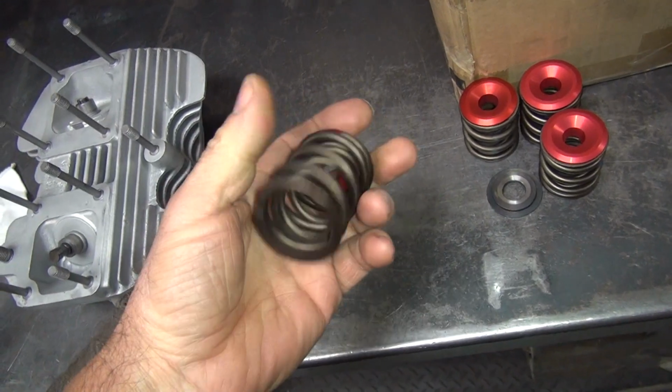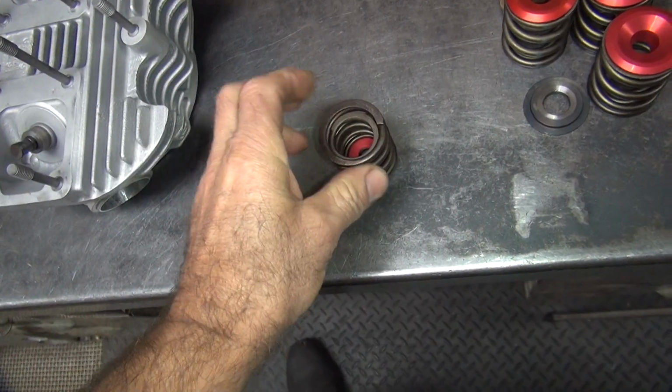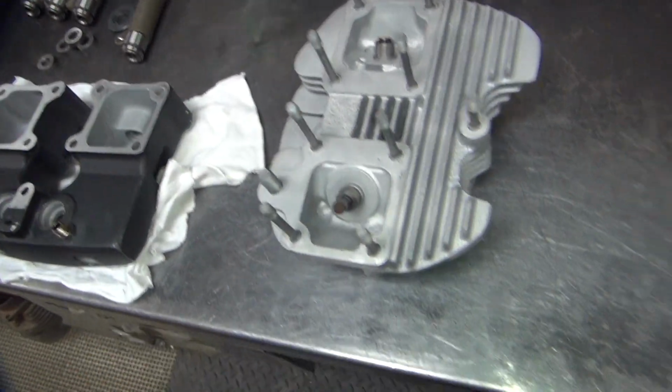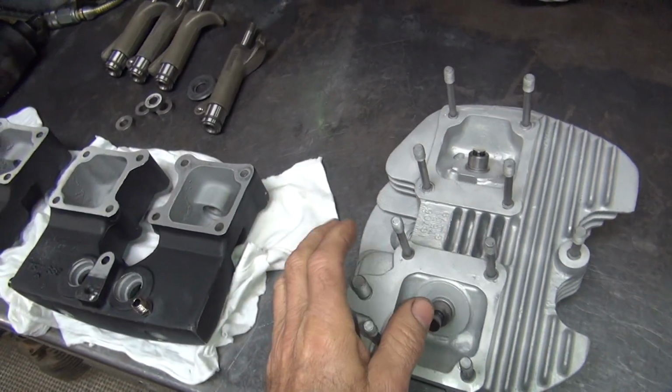The other way is you put the valve spring in there. You just throw the middle spring in there, a little thin one, and then mock it up with that. Put the box on it. Put this on top of the motor and then stroke it through with the cam and everything. So that'll be a real world check.